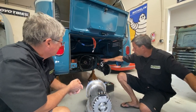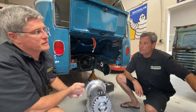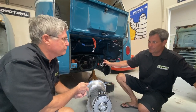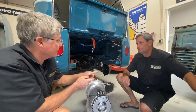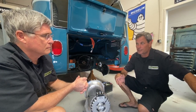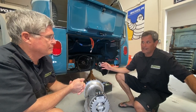We added a heater blower over here, so the vehicle will have a heater with forced air instead of the regular heat exchanger that requires vehicle movement to work. And most importantly, defrosting — you want to keep the windshield clear when it's cold. We're going to use the factory ducting, so the heat is generated back here and pushed to the front, just like in the factory setup. I tested it and it works really nicely. It's the one option we really try to hard sell because electric heaters work so well in EVs.